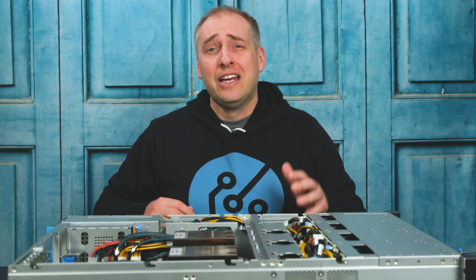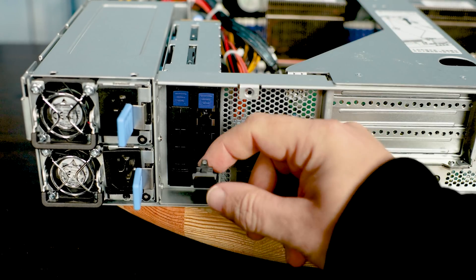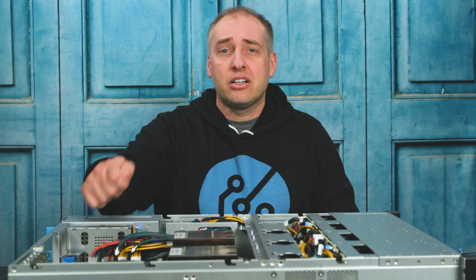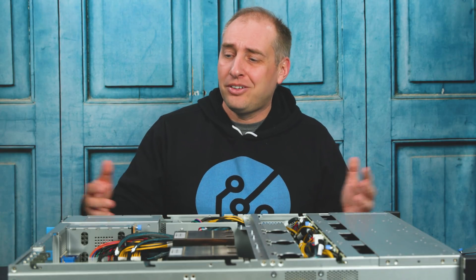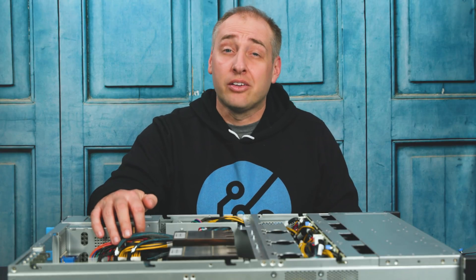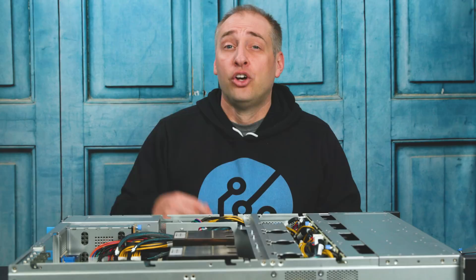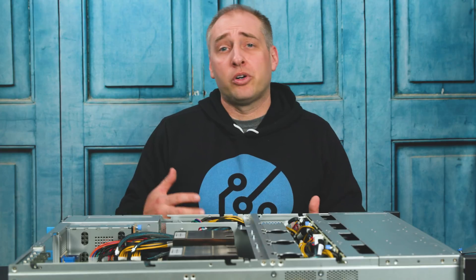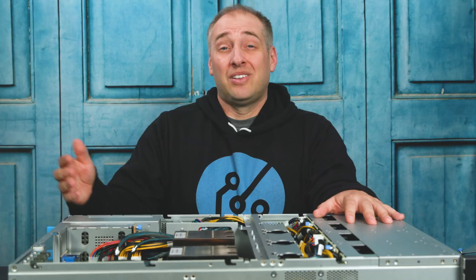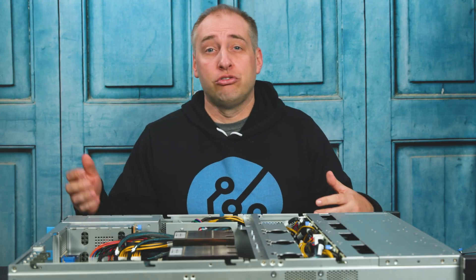The lack of onboard M.2 makes sense given this feature right here — a dual two-and-a-half-inch drive bay rear-accessible solution. The idea is you have two SATA bays for boot SATA SSDs with the ability to hot-swap them, which you can't do with M.2 SSDs, making this more serviceable. There's also a slim SAS connector on the back of this PCB backplane, and my guess is that you can wire up NVMe SSDs into these rear drive bays if you want an NVMe boot option. This also lets you run all 12 three-and-a-half-inch bays up front while still having two cache drives with NVMe in the rear — or technically four NVMe SSDs up front plus eight three-and-a-half-inch and two two-and-a-half-inch SATA drives.